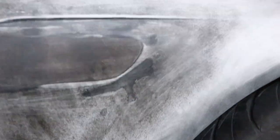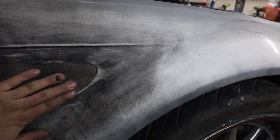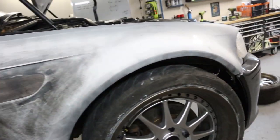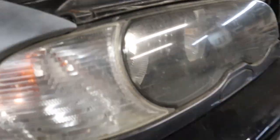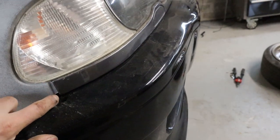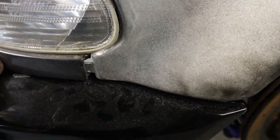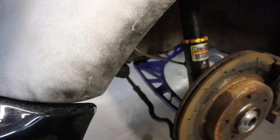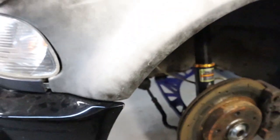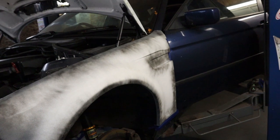This one's not as bad but I've filled in this area - it's smooth there, maybe just needs a little more sanding. I'm going to fill in a bit more here where there's a gap. She's good to go - I just need to massage this in a little bit as well. I'll use some filler here, same on the other side. Once the light gets pushed in I'll fill in a little more and lift up this bumper because it's all loose - let's get it all back together.